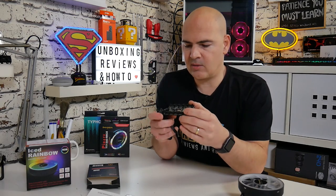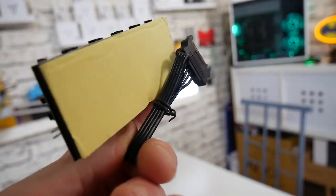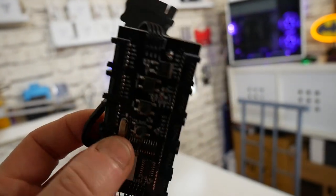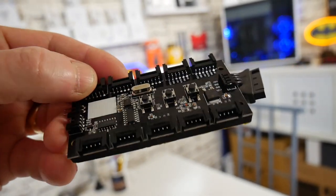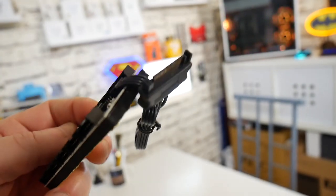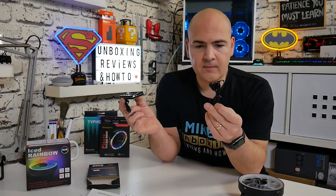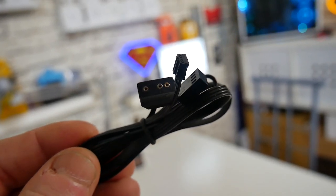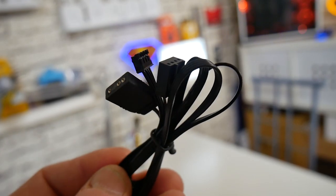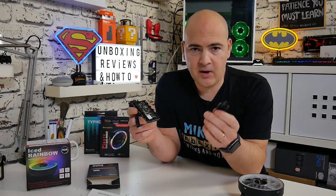This is the brains of the operation — the main controller. It connects on SATA for power and also has connections for up to 10 RGB devices, all using the Sahara 6-pin connection. You've also got a connection for a reset button or an RGB changing button, so if your case has got a dedicated RGB button — just a 2-pin connector — you can plug that in. Also on the end there's the connection for your motherboard pass-through. So you can use this as a dedicated controller, but if you've got a motherboard which supports things like Aura Sync, MSI Mystic Light, and all those kinds of things, you can plug the 3-pin addressable RGB header into your motherboard, connect the other end into the controller, and then control everything through your motherboard software. Total flexibility depending on how you want to set it up.